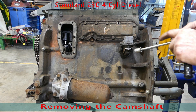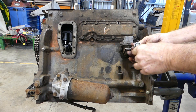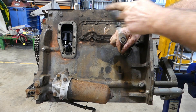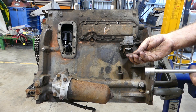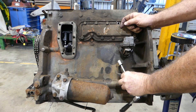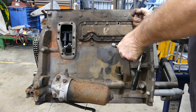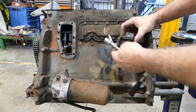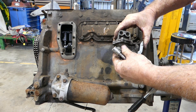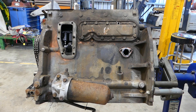We're back on this side of the engine and we'll just take this fuel lift pump out of the way. I use a little quarter drive ratchet — it's sticking a bit. It's only a little half inch socket, two nuts. Some of them have really thin-walled nuts on — probably later Perkins. We'll just pop them in the box; we won't be putting this back on again. Got the big leg on him — if they're making that noise it's usually a sign of a good pump, and that runs in and runs up on the cam.